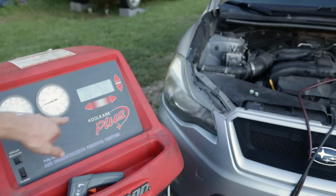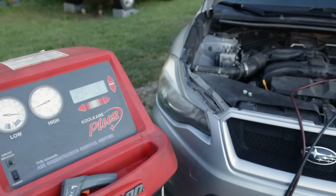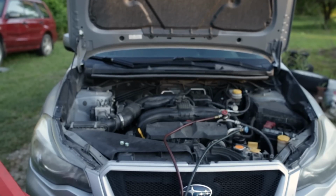You gotta press start to equalize our hose. Now we'll disconnect our high side hose, leave the low side hose connected, start the AC to max recirculate, and come back and hit OK. Always, always be careful when disconnecting your fittings, especially after charging. Schrader valves can stick open and you can have refrigerant blow into your face when taking these connectors loose. You want to be very mindful and careful doing that, because this stuff can blind you. It can give you frostbite.